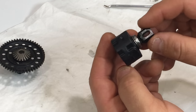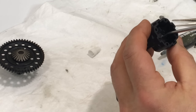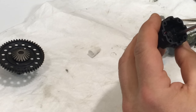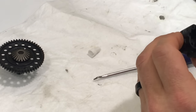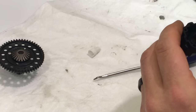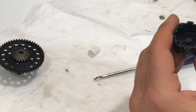We're going to install that out drive cup through there. The o-ring had popped up just a little bit out of the groove, so you're going to want to take some kind of tool and push it back down ever so slightly without compromising that o-ring - you don't want to rip it or break it. I'm going to use needle nose pliers to assist getting that back into place.